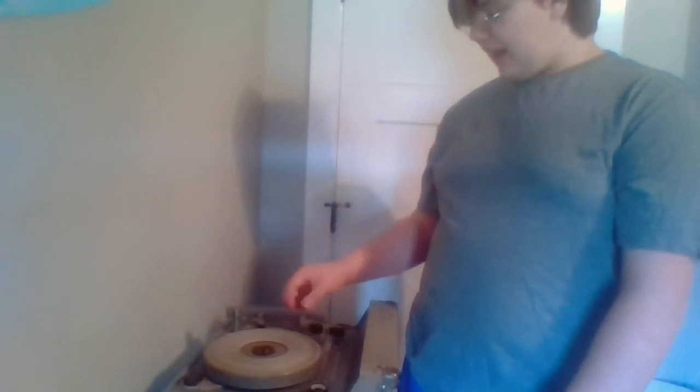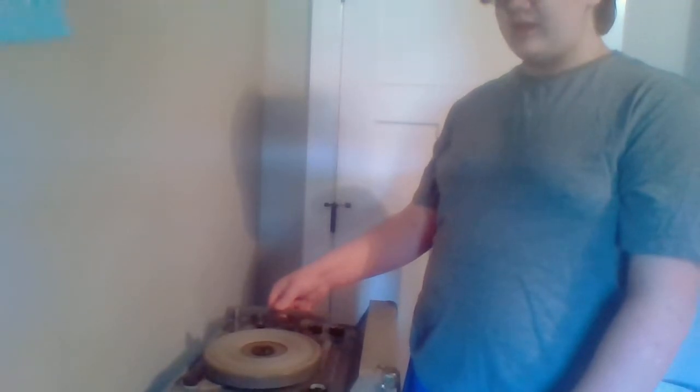The pickup arm, for this age, this portable record player has a battery input, and the batteries are still made today. It has adjustable tracking force and it goes down to one gram. I have measured it, and I have it set at about 2.5 grams right now. It's a set screw that you turn at the back to adjust. And it's even got a screw to tighten the clips that hold the needle down — unlike the Crosley clips, this one has a screw you screw down. So if you're moving this, the needle ain't going to come out.